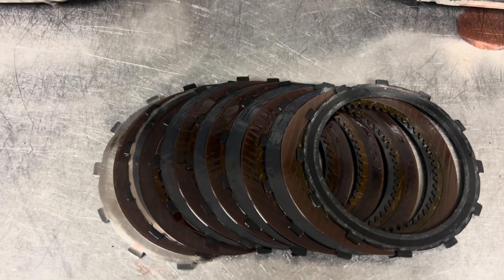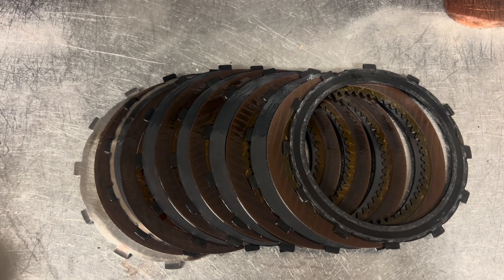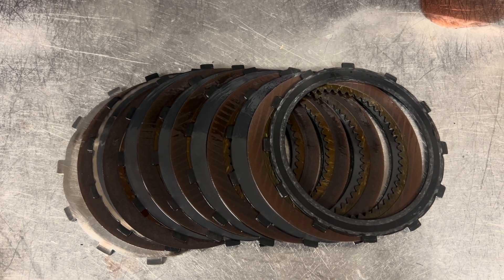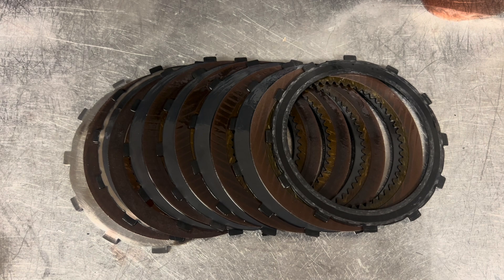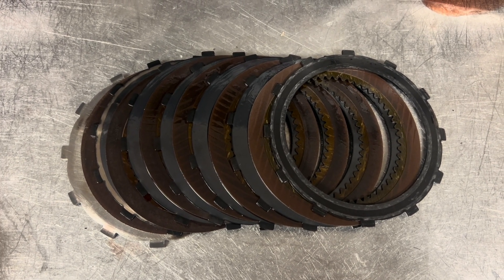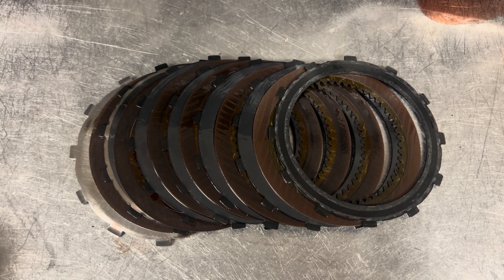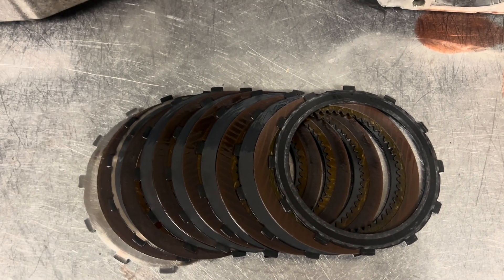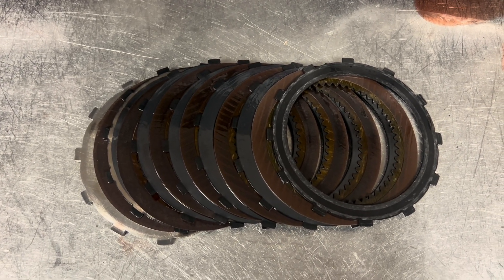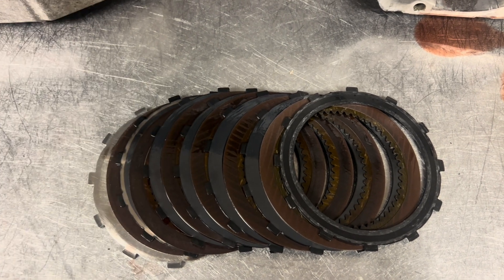As always, we separate the overdrive section first and take a look at the overdrive brake clutches. These have got some heat in them down towards the reaction plate. These are what's called an Alto black clutch — yes, I know they're not black, they're more reddish-brown. This was built a while back when we couldn't get GPZ clutches during COVID. These clutches are actually really strong though — we went 497 at 142 miles an hour with these in JP's transmission. I don't think they're burnt because they're not up for the task; they're just ready to be changed out.